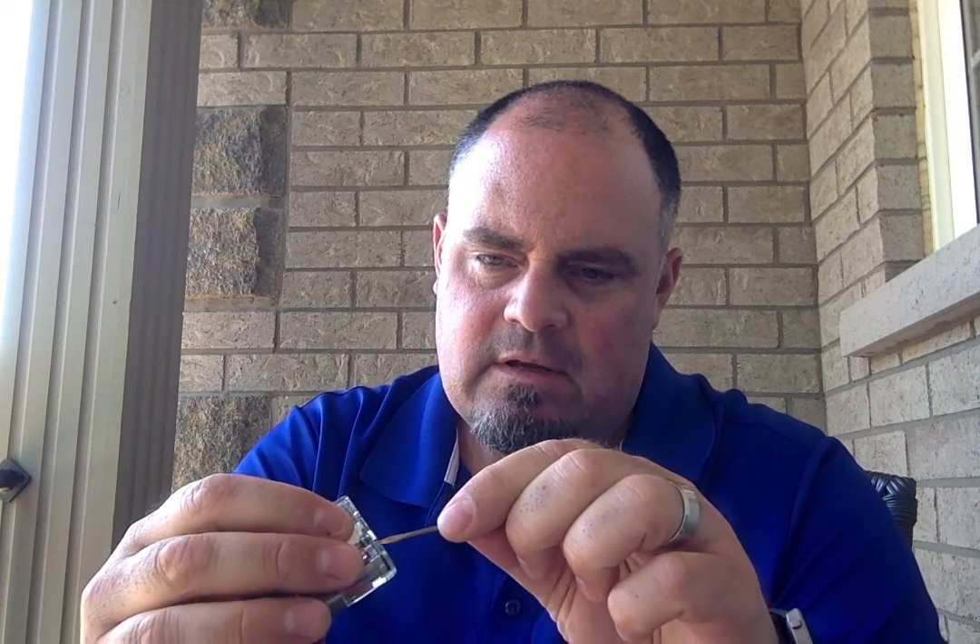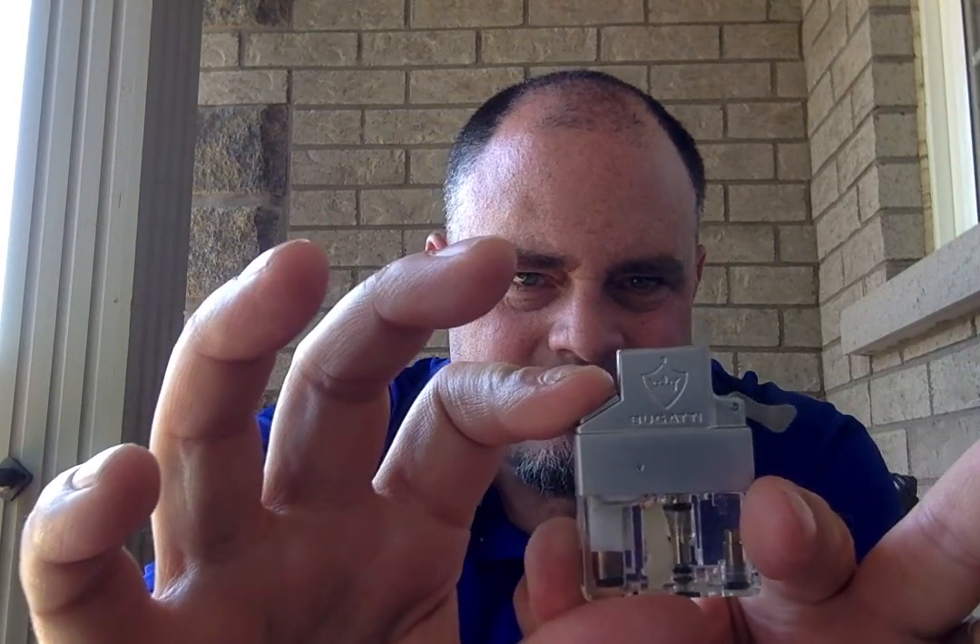So that's it. Now before I put it back in the cover, I just try to light it. Usually on minimum it won't light. A lot of times you have to warm it up too — you'll feel it's cold to the touch, especially in the winter. You'll have to bring it back to almost room temperature. So then I adjust it halfway. It's going out, so either I have air lock or it's not getting enough butane. I find with these Bugattis they like to be on almost high. And there you go — you probably can't see, but you should be able to hear the flame. You can see there's no air pockets or anything in there. That's what you want. When you return it to the case, good to go.